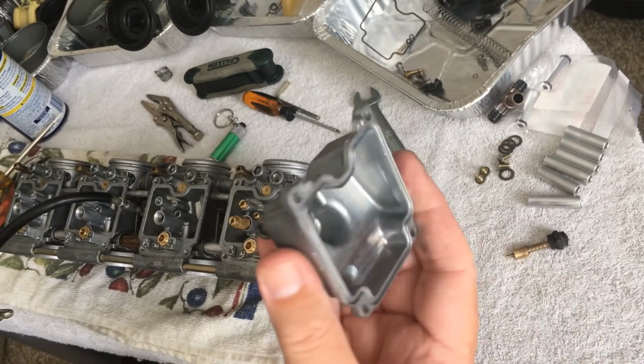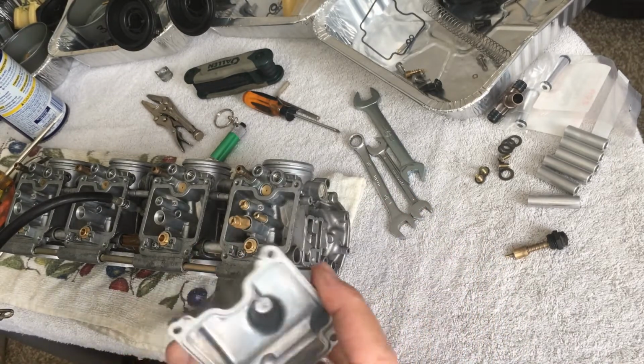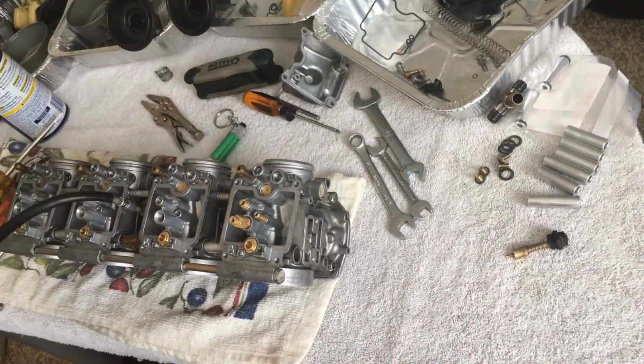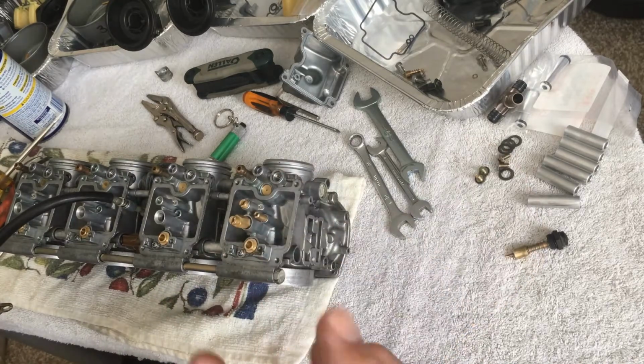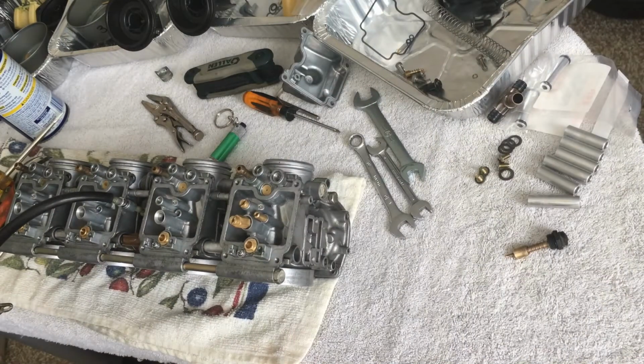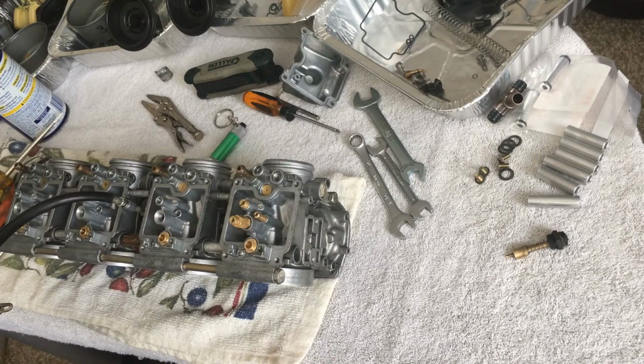even our B12 fuel additive, that's basically watered down. So while Yamalube is still kicking ass, I've got a couple cans of it because I already have it sprayed into the valves. After I took the carbs off, I sprayed some in every single air intake there on the cylinders, and I'm going to take the spark plugs off and put some in there. And they said that's the best thing to do.